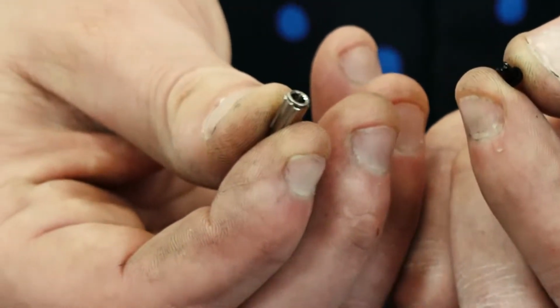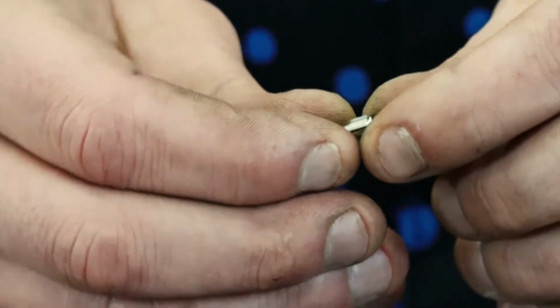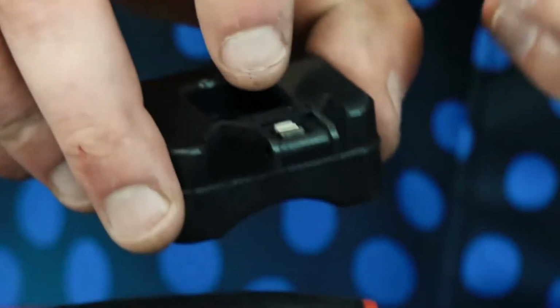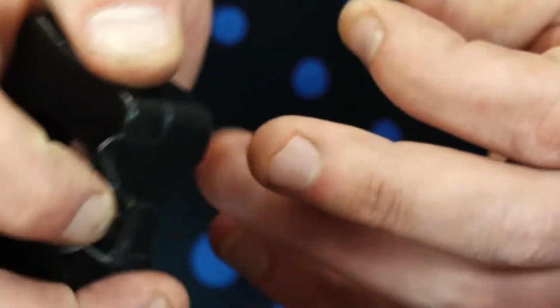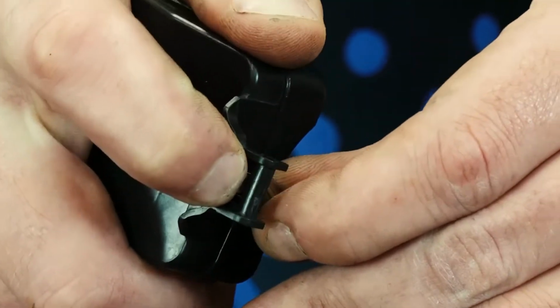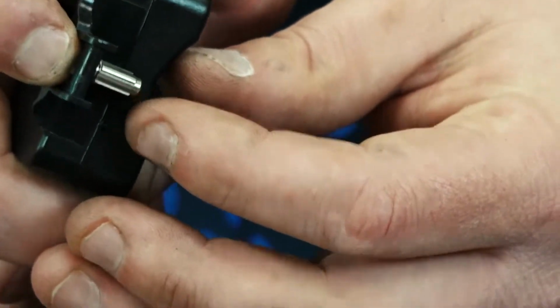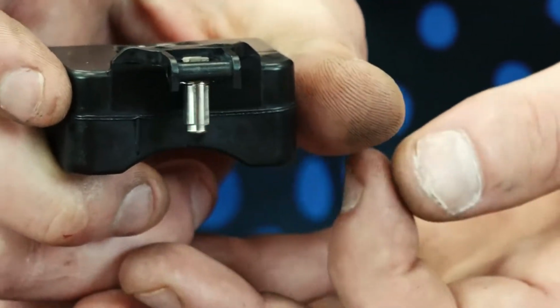We're going to make sure we take our little rubber cap that came in our carburetor repair kit, and we're going to place it on top of our new float needle. I'm going to take my index finger on the float, and push down. I'm going to apply pressure on the clip to get it to stick. And I'm going to take my needle and click it in just like that into the groove. That way the needle is set onto the float.